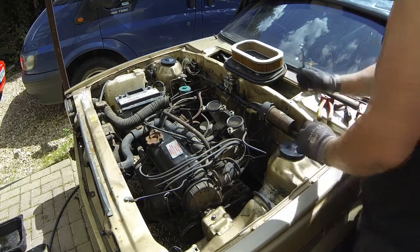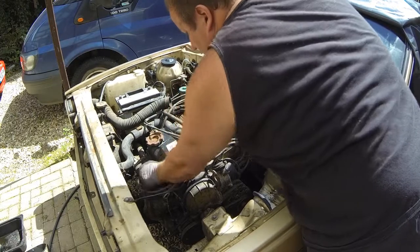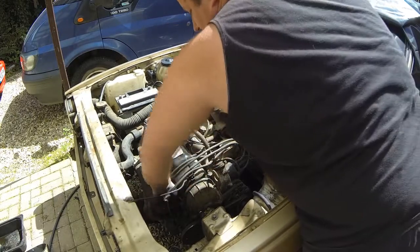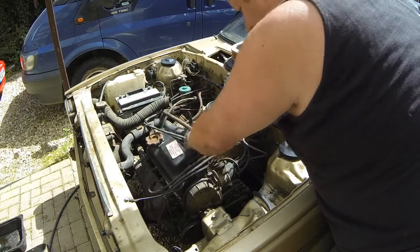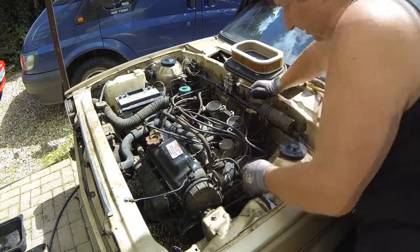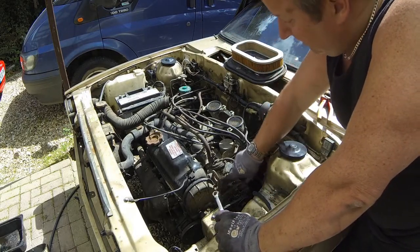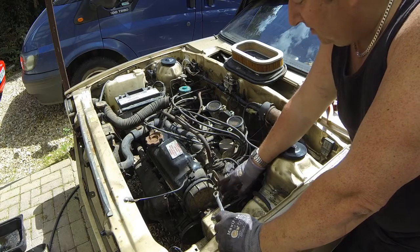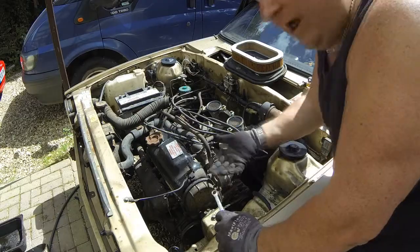So that's what I've done there. More items to be removed - just pull the plug leads off. These have to go back in a certain order, but I've got the manual so I'm not too worried. I'm not stripping the engine down, I'm just making it easier for refurbishing certain parts that need to be cleaned up. For example, this distributor body is all corroded with aluminium oxide, so I'm going to give it a quick rub down with some wire wool and a coat of silver paint just to make it look fresh again.